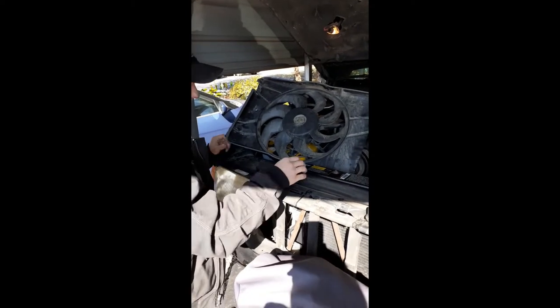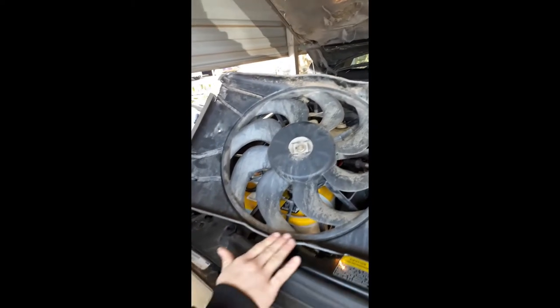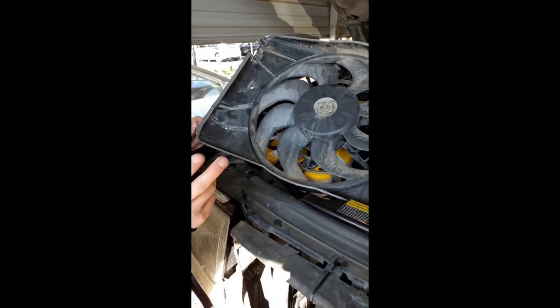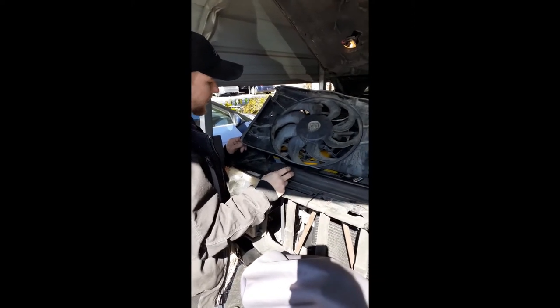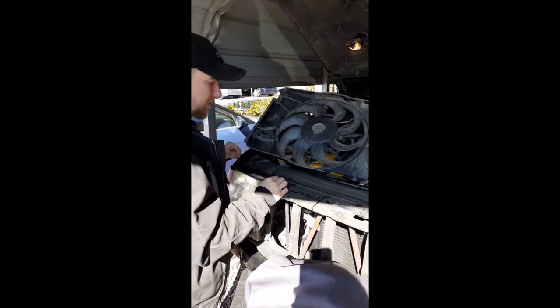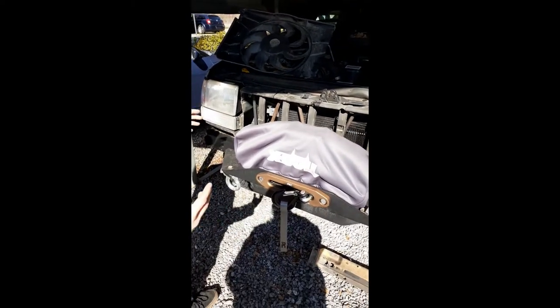And then I put 3M tape right there, so it's not gonna be rubbing on the fins or anything too bad. And I'm gonna drill a couple small holes and put these zip tie deals where it goes through the fins of the radiator. Then I just put a cap on it, pull it tight, and snip the back. I'm gonna have my AC condenser loose, and I took the bottom holding bracket off, so all that's loose and I can get those little zip tie pieces in there in the back behind it to hold it in place, and then I'll do my wiring.